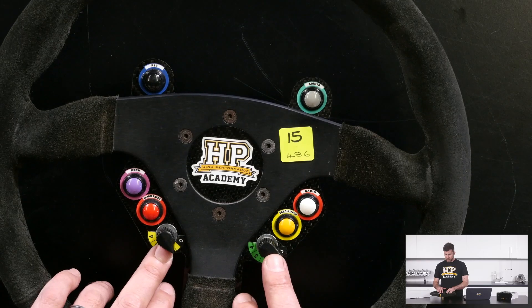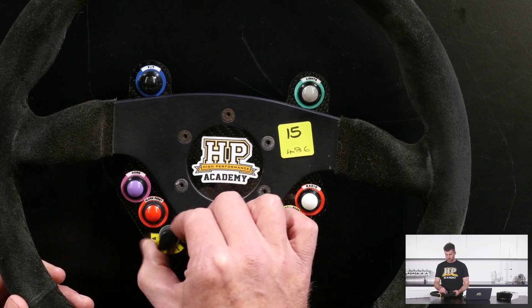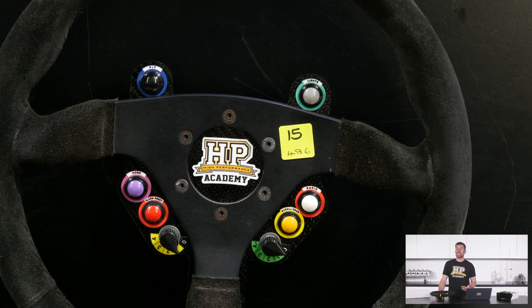On the bottom of the steering wheel on the left hand side we've got a couple of multi-position switches — the one on the left is for our traction control, the one on the right is for launch control. These allow us to adjust those settings on the fly depending on the track conditions. One of my pet hates is that a lot of switches on the market will be 9, 10 or 11 position switches, which sounds great in theory but sometimes less is more. We've got four or five positions in both of these switches.